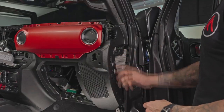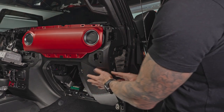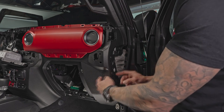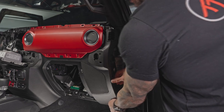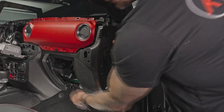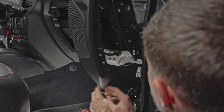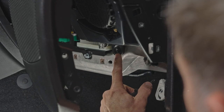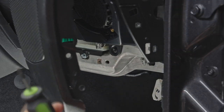After those five screws are out, that's all the dash panel screws needed to flex the dash panel out of the way to get the pod out. There are still two more screws holding the pod itself. Pull lightly up on the bottom and then the top, and it pops right out — giving plenty of room to access the speaker pod. The last two screws are one on the side and one in the bottom of the pod inside the glove box. Use a stubby screwdriver for the bottom one.